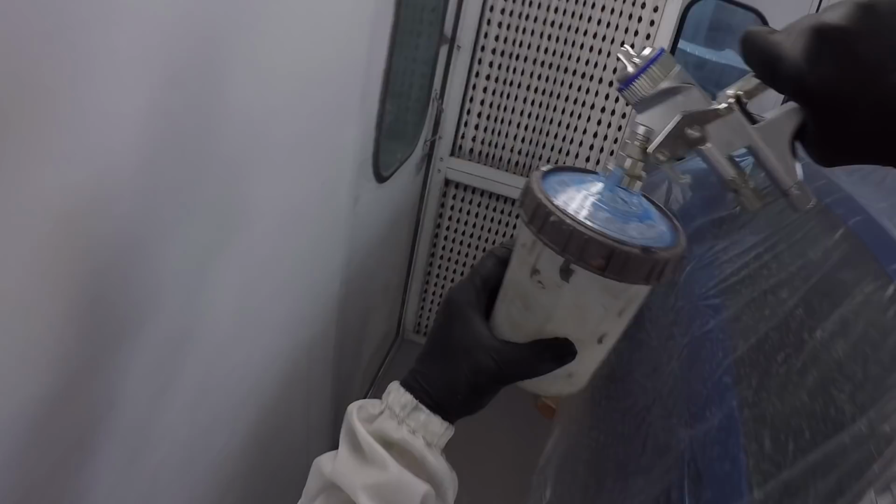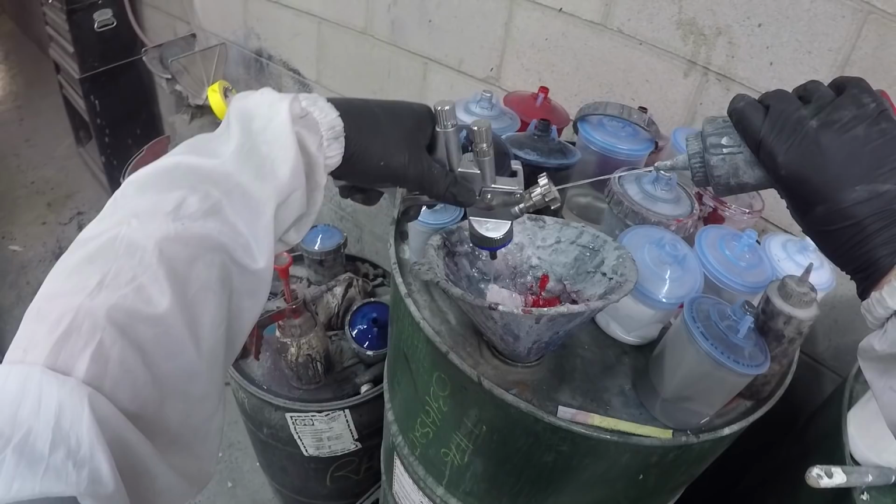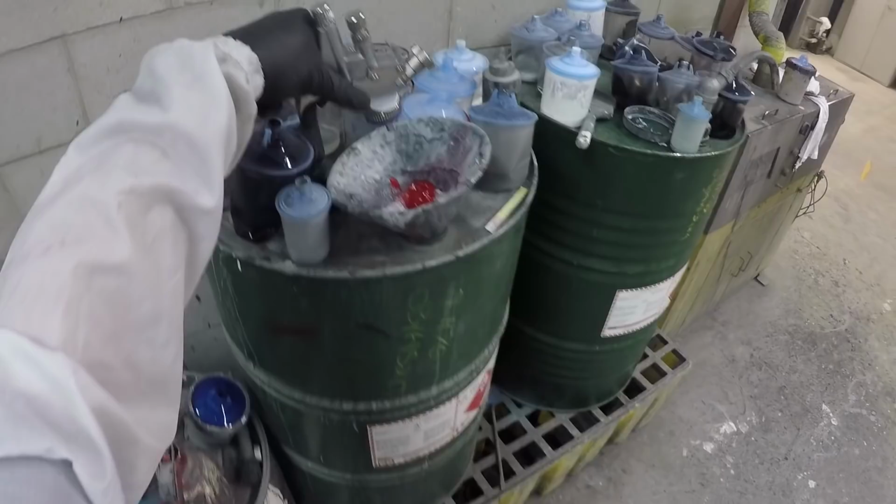I mean, these bumpers, they're a little trickier than you'd think. A lot of guys start out thinking maybe, I'll get my feet wet spraying a few bumpers, going from the prep to the paint. But bumpers are actually a little bit more tricky than doing, I would say, a fender and door. Just all those offsets, it's tough to get in a rhythm on what to spray. You can run the clear in those pockets in a heartbeat. You may think they're easy starting off in the prep, but trust me, that's probably one of the more tricky things that you'll be spraying. But it's good practice anyway.